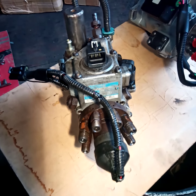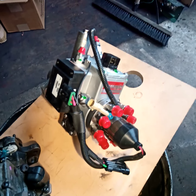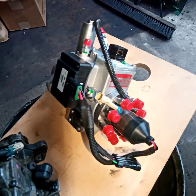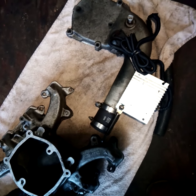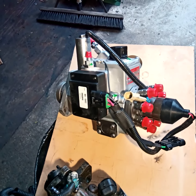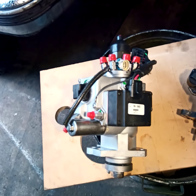The cost for the pumps varies tremendously. To be fair, I bought the cheapest complete pump I could find, and that was from Pensacola Diesel in Florida — this is what they gave me. I purchased this one because it came with the PMD attached. We already had a new PMD mounted on a heat sink up on the manifold. With this pump, I got a new pump with a new PMD, and I presume it was tested before shipping, so in theory it should work properly when bolted in.